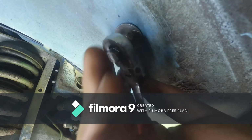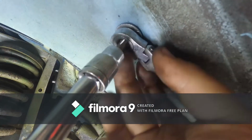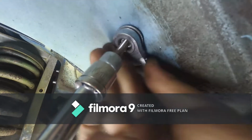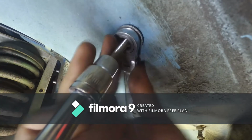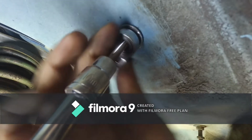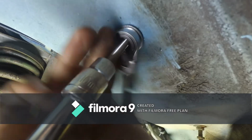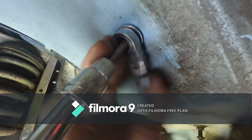Okay, the bolt is now spinning with the nut, which is something that I definitely don't want to happen. So there we are. I believe we are tightening this roll nut now. What should be happening, and I hope that this is noticeable in the video because I can't see it with my eyes, is that the bolt should be appearing to be longer the further I tighten this nut. So what I'm actually doing is pushing the opposite end of the bolt by squeezing this nut harder.